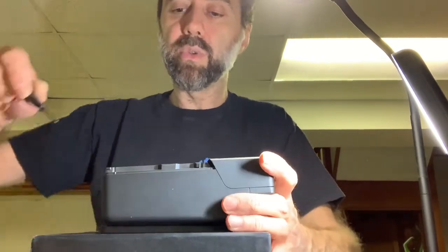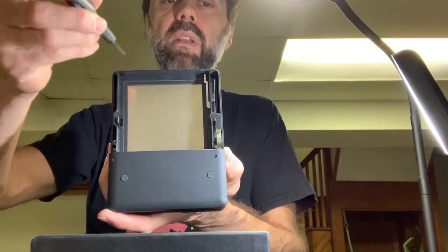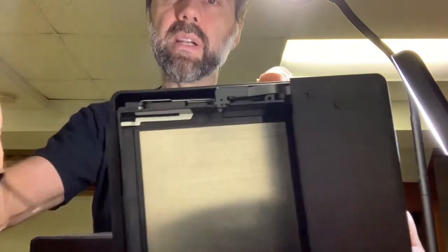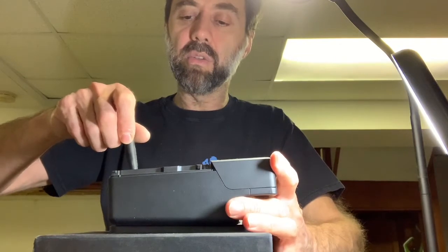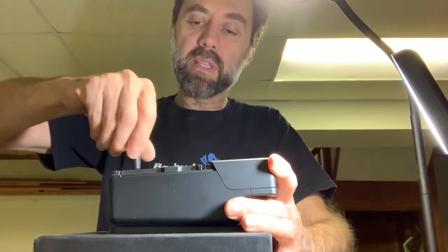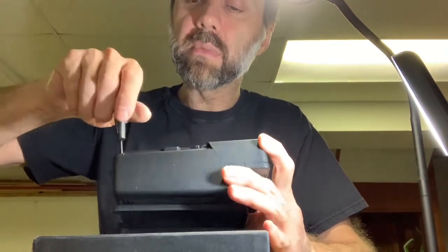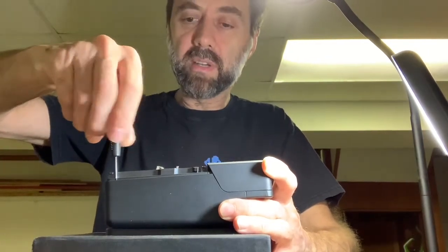The reason we removed the back cover is that on the inside of the Lab there are two other screws holding the top — one here and one here. They're not very visible but they're in there. They're very small and you really don't want to lose them. Note that all the adapter kits I'm shipping now include replacement larger screws, so losing them isn't a tragedy, and they're interchangeable.